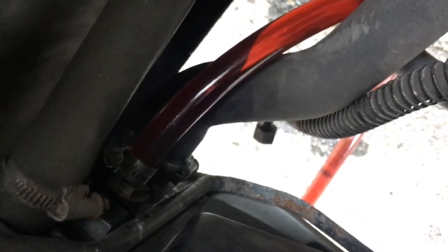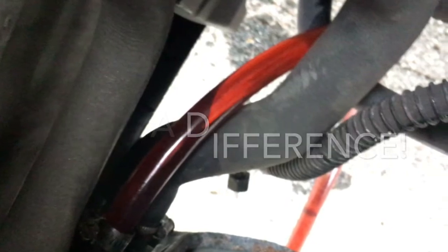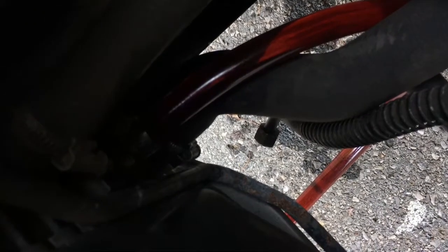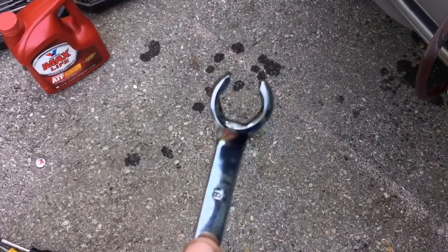One last quick video before I take this line off — I wanted to show this because it's a great contrast, the color of the fluid in the line now versus what you saw at the very first video. Also, some people spend a lot of time trying to figure out how to do a fluid flush from the banjo bolt up top, but that's much more complicated. The flange-type connections down at the bottom are totally bombproof and super easy to connect and disconnect. I recommend using a six-sided closed or open-end wrench so you get the most grip and virtually no chance of damaging that fitting.